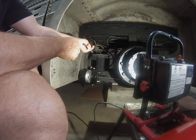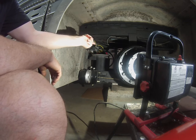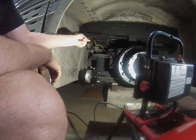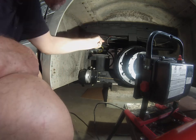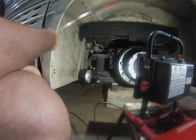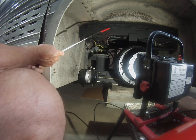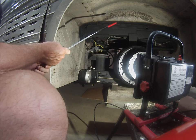These plates are not as much of a problem because they're super thick — you take a needle descaler or an air hammer and knock the rust off the top. The problem is here where these plates are only an eighth of an inch thick, and this formed channel frame section is also about an eighth of an inch thick. So I took all four of these plates off and made sure there weren't any issues on the other side. Where most of the weight is with the engine and the transmission, I did have a couple of cracks, so I welded those up.